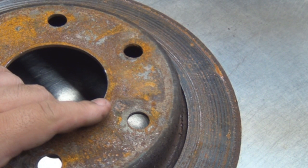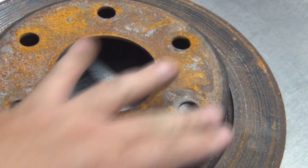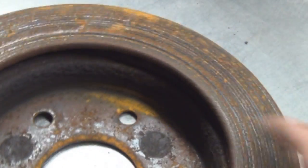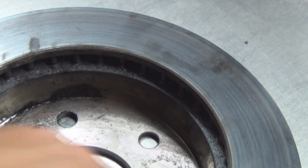I'm going to show you how to measure a brake rotor and how to find the specs. On brake rotors, you usually find the specs as a minimum thickness — it would say MIN and probably THICK, something like that, stamped somewhere around here or here.